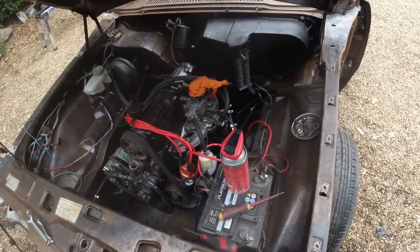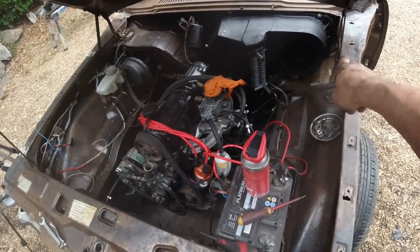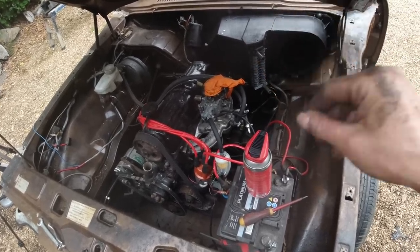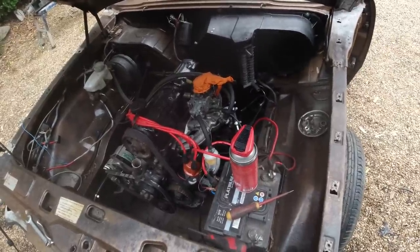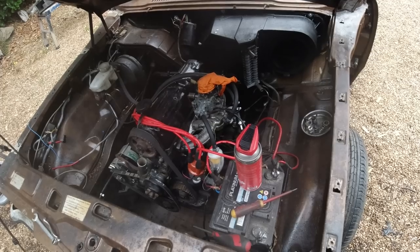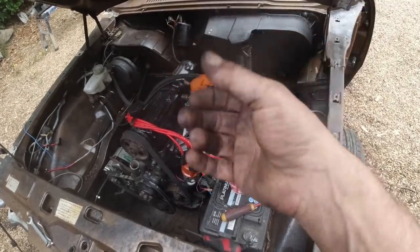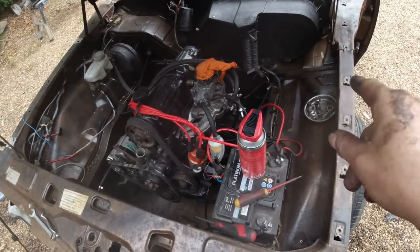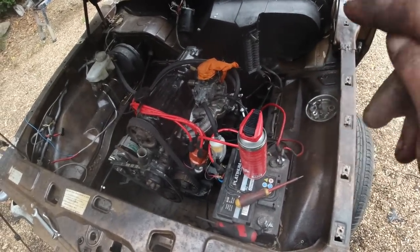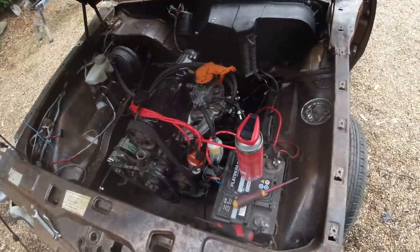If you've got a fiberglass housing, you need to upgrade the fan housing lid to plastic, and then you route out the plastic using a combination of Dremel and RTV silicone, and you drop a Yaris motor in. You have to upgrade your cables though. You've got to do a dedicated high power feed to the motor. You can't use the Cortina's engine bay loom to power it if you're doing a Yaris motor upgrade.